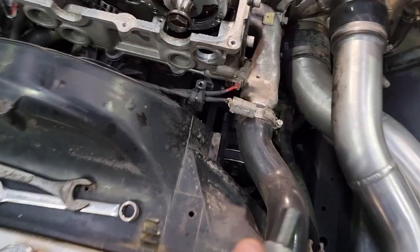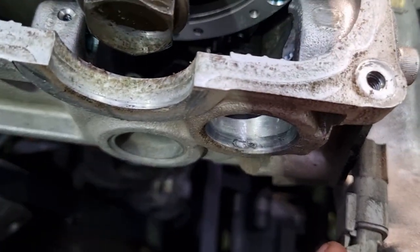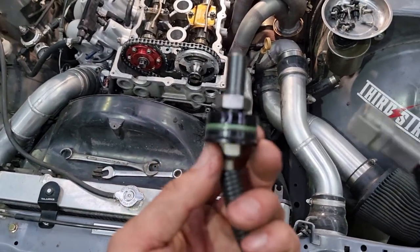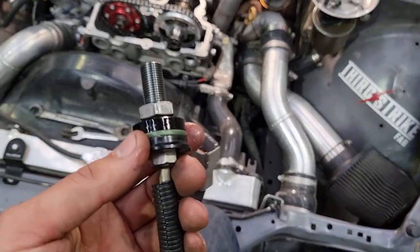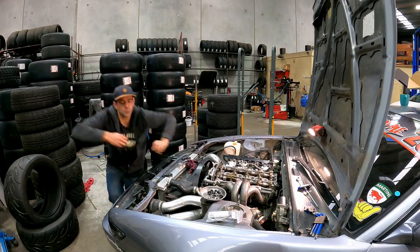It didn't hold very well once I started turning the... you can see the little divot where it was, it started turning. And we then just pulled out from the O-ring. So we'll just have to make sure when I put this back together, I do that Allen key grub screw back up and hope it holds, and check it again before I put everything back together.